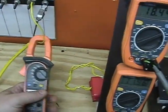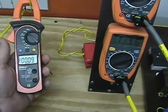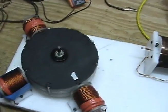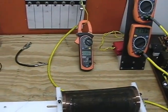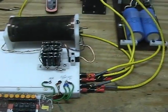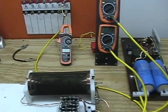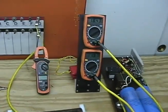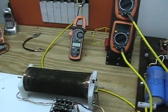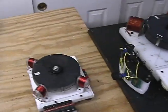I also recommend always having an amp meter on your battery output into the motor — your drive battery — because if you crank this up and start dumping 10 or 12 amps into it and you're not aware of how much amperage you're drawing, you can easily fry everything. Without an amp meter you risk frying everything just by putting your foot on it. You have to be able to monitor the amperage you're drawing from your battery. If you don't do that, you're asking for trouble — word to the wise.